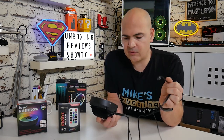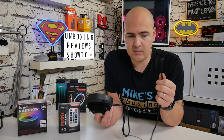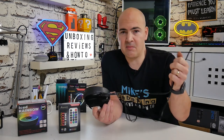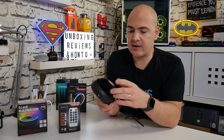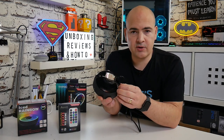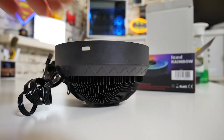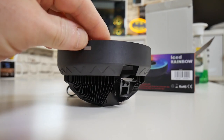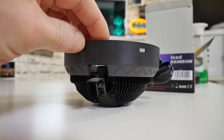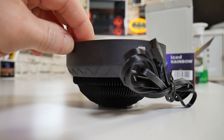That is a problem with some of the fans I've noticed recently — the wiring seems to be getting shorter and shorter. So if you are trying to do some sort of custom fitment or you've got an RGB controller to plug into, this lead is going to be more than long enough. Now the mounting clips on this are something of interest. This is just your traditional AM2, AM3, and AM4 push clip, so all you need to do is push on the levers to attach them over the lugs, which are standard on pretty much every AMD motherboard in the last 10 to 15 years. So this is going to be really easy to fit on pretty much any CPU.